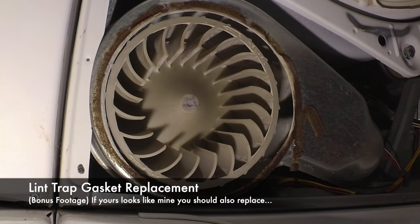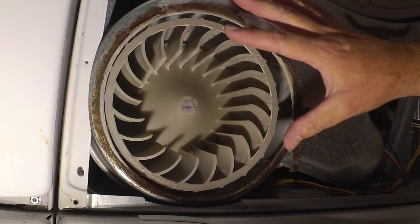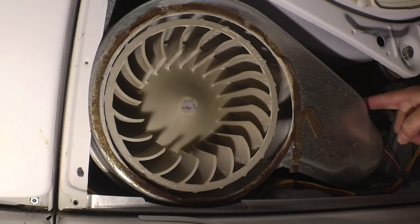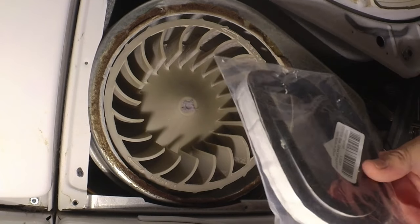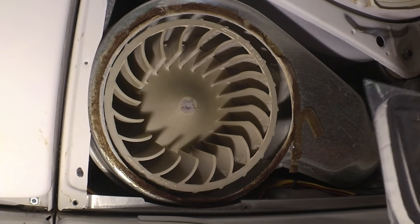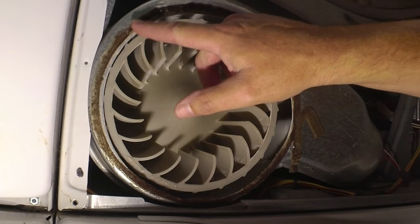All right, so we've got the dryer working again. One of the things that we found when we removed the lint trap so that we could get easier access to the thermal fuse and the thermistor was that this foam gasket, quote unquote, is in pretty bad shape, and it's probably why we're getting a lot of lint inside of the dryer. So I ordered a replacement piece of foam that I think should work. I'll share the link in the description if this goes well. But I'm going to try and scrape off what's left of the old one.